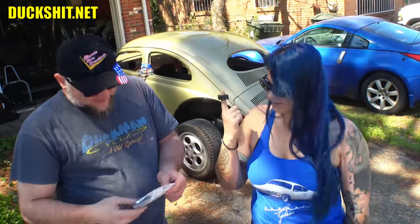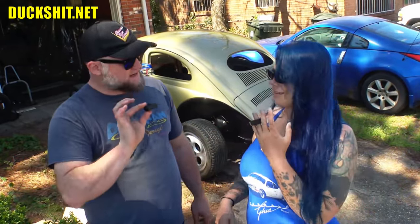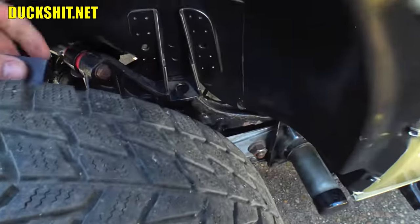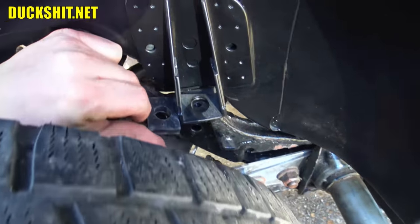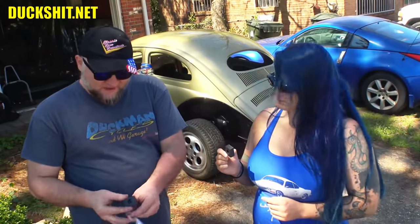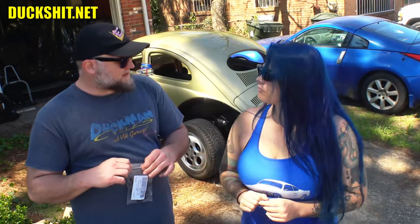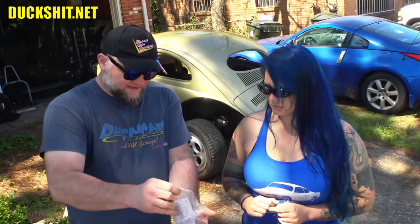These are a little thicker than stock. These are 17 millimeter. The reason I got thicker ones is in case I need to adjust the doors. You say, well, why does a body block adjust the doors? When you raise and lower the corners of the body, it will tweak how the body fits around the doors. So if there's a little gap I need to open up somewhere, I could put a bigger or smaller block in the corner, or even no block at all. Although you might have a body squeak in that location, but maybe just a little piece of rubber instead, like cut up a tire tube. But I needed some taller blocks just in case, so I wanted to have them before I started bolting things down. Here we got something else.